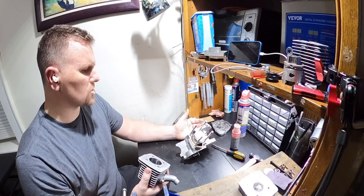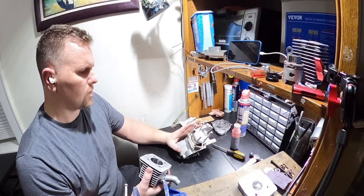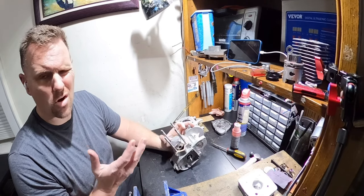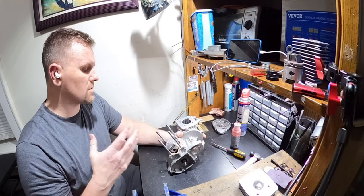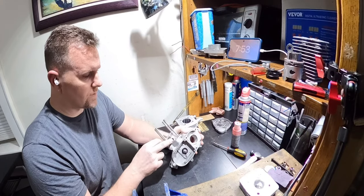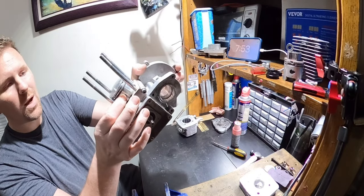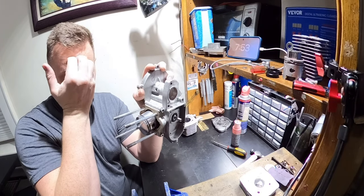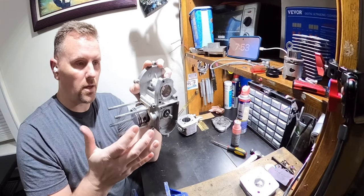Just going over everything, making sure I got everything right. I got to put a little ultra slick on the piston and the ring, so it slides in and doesn't have a dry start when it starts up. I do that to all the bearings. I did cut the ears off of the circ clips, like always. I put my reliefs in the piston, like always. I drilled all the way through the wrist pin land, so it's a larger oiling hole that goes all the way through.